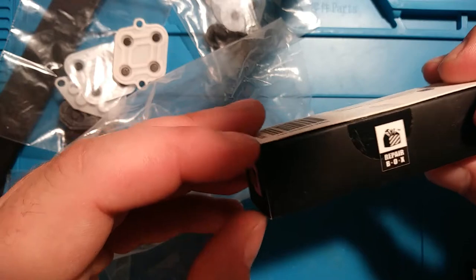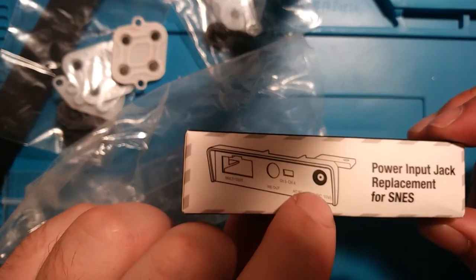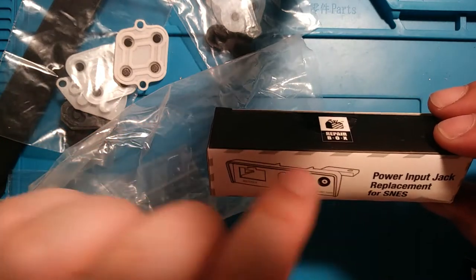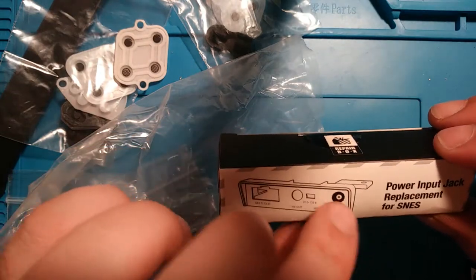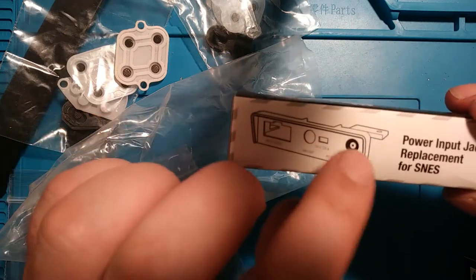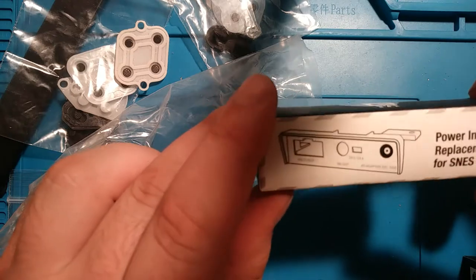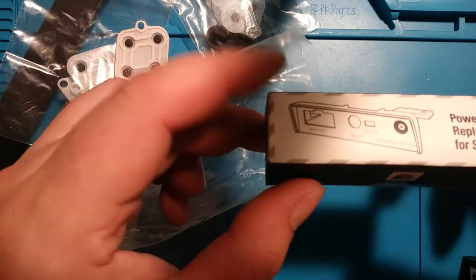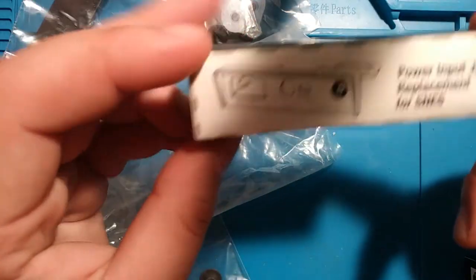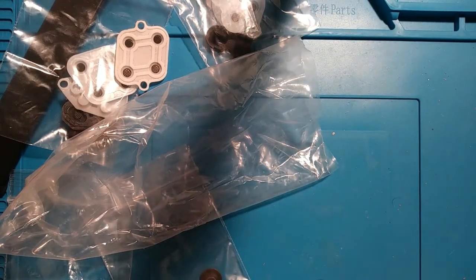Power jack replacements — I've used one of these before on the American Super Nintendo. I think the PAL version uses the Super Famicom type plug. There's a plastic insert, a plastic barrel in the middle that's taking all the load instead of just a metal pin, as on the NES and pretty much every other console from that era. I've seen more than a few of them broken. I've actually cannibalized a Super Famicom and put it in a Super Nintendo to replace the power jack, but this is a better solution so you don't have to cannibalize another system. I got four of those.